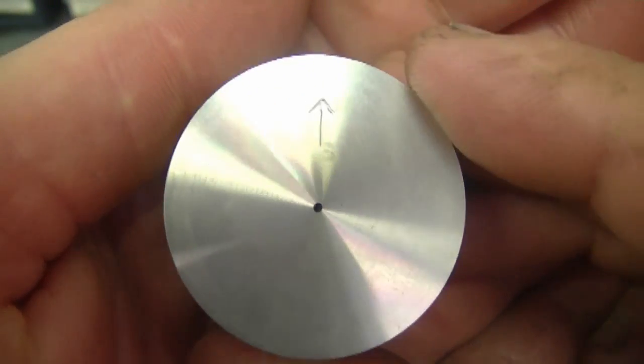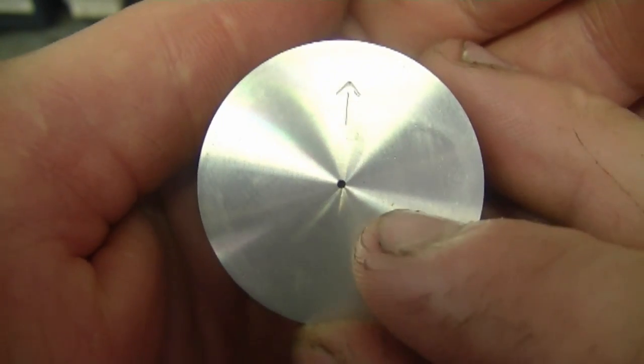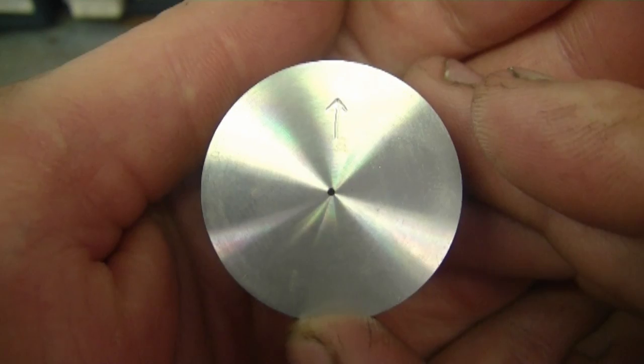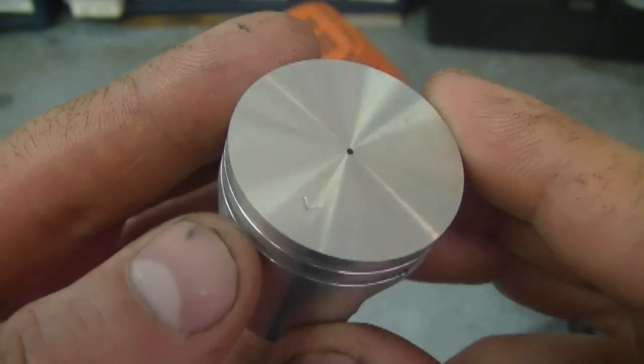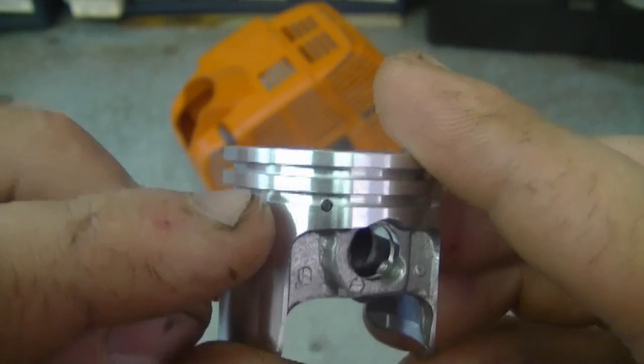Here's a close view of that arrow. So the question is: which side of the engine should this be pointing — the intake port or the exhaust port? The answer is the exhaust port, and always the exhaust port in a two cycle engine. The reason you want this arrow pointing at the exhaust port is because the rings do not join in any port this way.